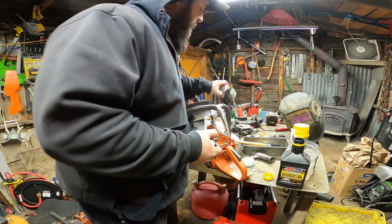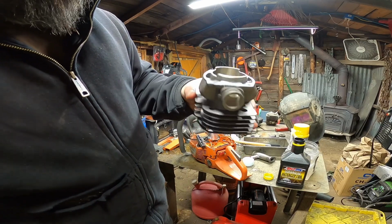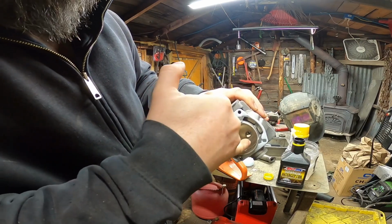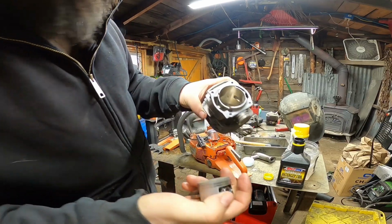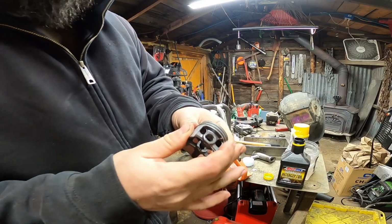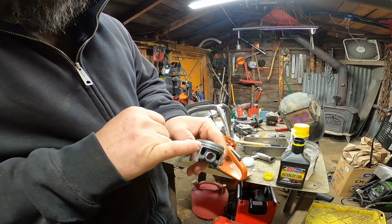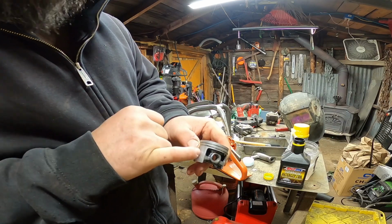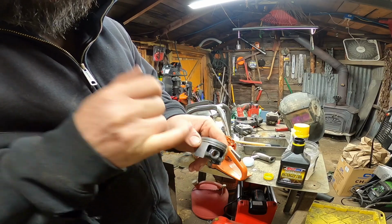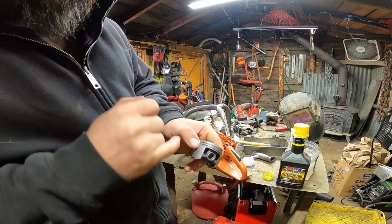These ports, oh, that's the brand new cylinder, you dummy. Yeah, they'll get hung. You'll hang a ring, it's no good. But what I was going after is these pins are steel. So the aluminum heats up quick, the pin starts walking if you're revving the snot out of it before it gets uniformly warm.